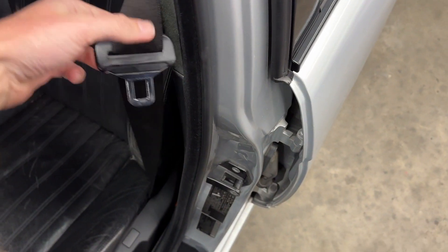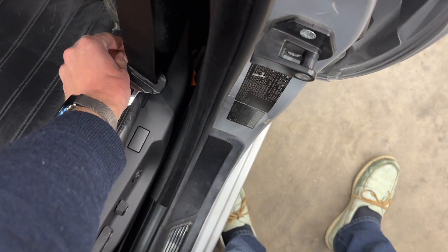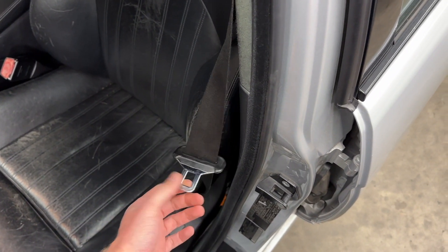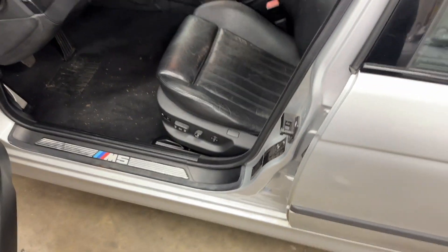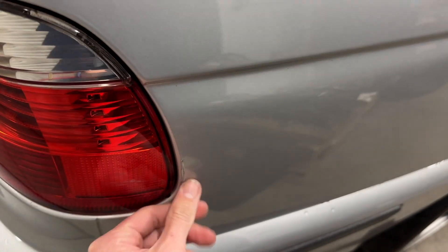The next project is a dumb one. The seat belt is supposed to have a little black button in it that prevents the belt from falling down lower than a certain point, and that's missing — so the belt falls all the way down to the seat trim. I have the new button but there's a special tool to put it in. BMW doesn't have it; it's four weeks away in Germany. I don't know if I want to waste $45 on that. They say you just heat it up a little and use pliers to snap it in — it's kind of a plastic rivet. I'll try my hand at that, probably ruin the piece, and then end up buying the tool. I've got some body work quotes. They want to repaint the entire left side of the car going back to the fender because of some damage there — that'll probably polish out on the light damage. They say this door has filler and has been repaired before, and now that they say that I can feel it — it flares out at the edge, which it should not do. They say it's all repairable: PDR here, repaint this, repaint the handle, and they think they can take that depth out of the body line.